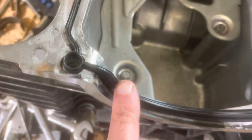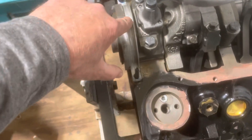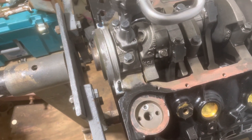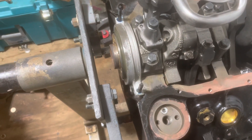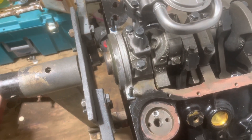Having put the gasket in the new oil pan, this gasket has a fairly narrow strip at the rear. But looking at the rear main seal housing, it's not a narrow slot — it's a pretty wide surface. That made me stop and think something doesn't feel right. I was thinking maybe I had the wrong rear seal housing. When I build motors, I throw all the parts for a particular customer's engine into one big tub and nothing leaves that tub until I'm ready to put it back on. I fetched this part from the customer's box, but this wide gap doesn't seem to jive with the narrow seal that the gasket has, and it made me wonder if a part had accidentally been swapped.